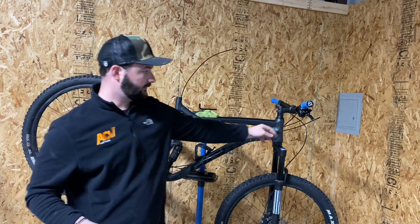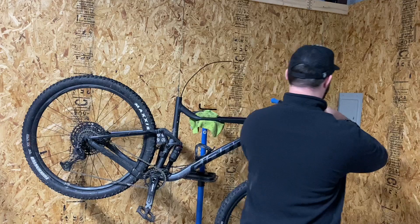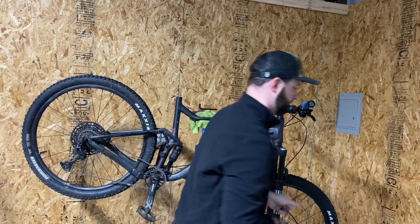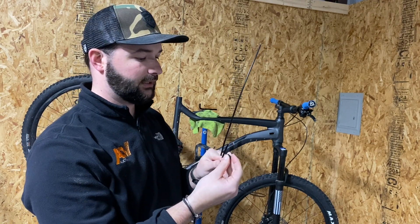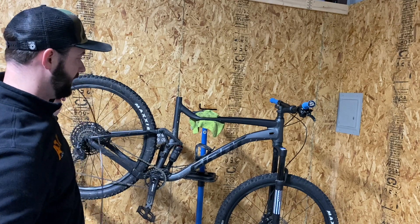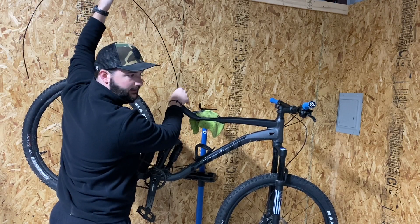So I've got the cable already ran through. I'm going to yank it out real quick and probably regret it, but try to put it back in and see what happens. What I've found is you want to get a plastic cable cap in. When you're trying to force this through the frame, the little burrs on the cable can snag on the frame and make it difficult. So just put a plastic cap on there, make sure it's pressed on really good — it'll help it slide a little bit too. On the Giant, it's going to look crazy, but it's almost like a helicopter approach. Slide the housing down into there and you'll feel a very significant stop.